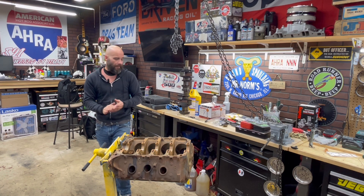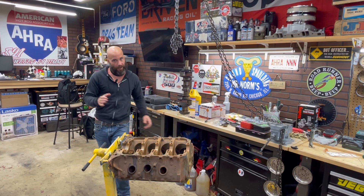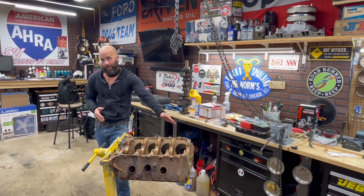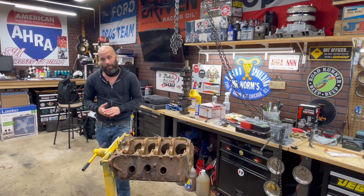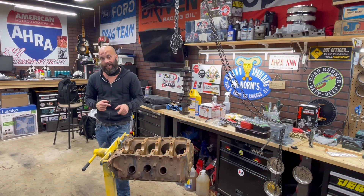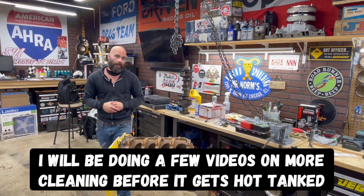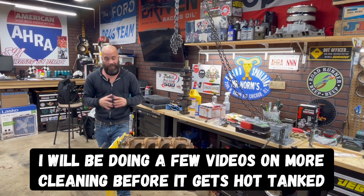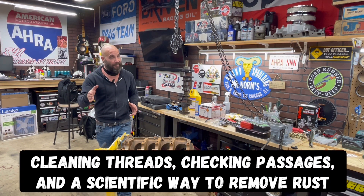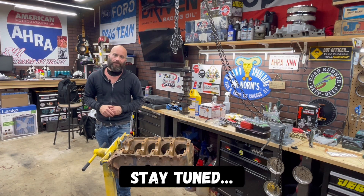There are another few steps that I do before I go to a machine shop. Most reputable machine shops, even though they're going to hot tank it, will go through and chase all the threads to make sure they get the contaminants out — and that's important when you go back to torquing bolts. But just to make sure, I always take care of that myself. Before I go to a machine shop, there's another step I'm not going to tell you about now, because in another video I'm going to show you a cleaning step that helps remove rust. I really hope you enjoyed this episode of how to tear an engine down to get ready to be rebuilt. The correct way to clean an engine block — and I'll stand by it — is go to a machine shop and have it hot tanked. We'll see you in the next one. Thanks, guys.